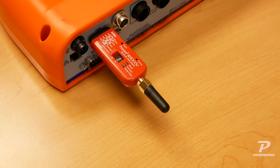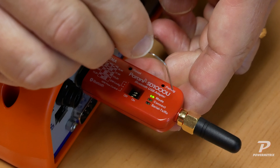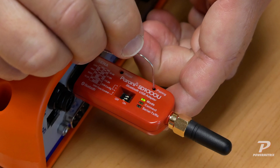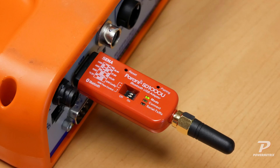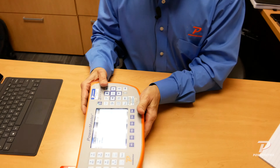I'd suggest holding the bottom of the Bluetooth adapter so that it's a stable connection. Put your paper clip into the paired button — you'll feel a click — and hold it down for a couple of seconds. You'll know it's been reset because the light will now be solid. Then we're going to go into pairing mode. Hold the bottom of the Bluetooth adapter again, put your paper clip in until you hear a click. We are now in pairing mode, indicated by three flashes.